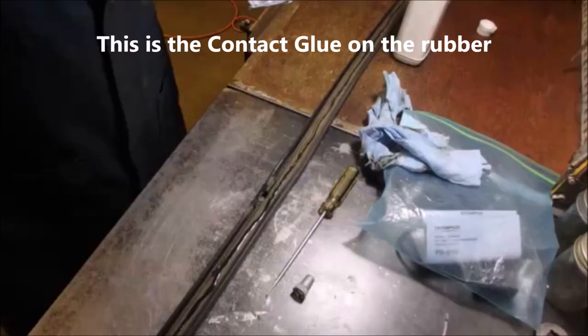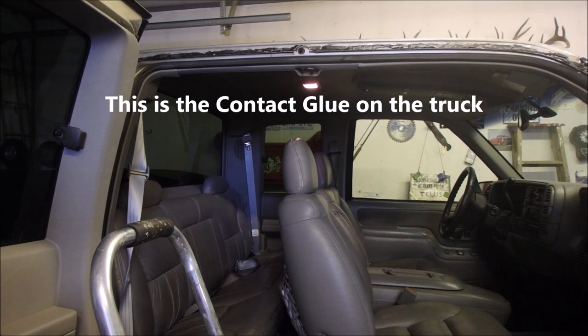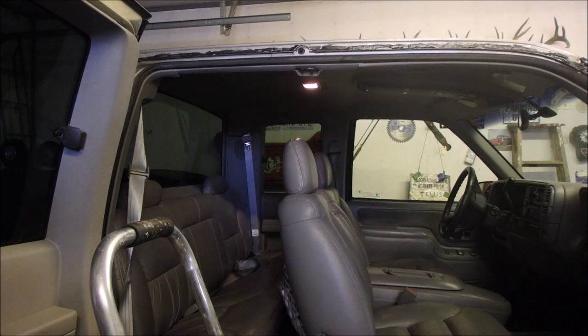Good. Now I'm just going to go clean the ridge of that, where the weather stripping goes on the truck. I'm just going to take a little tiny bit of brake parts cleaner and wipe that off. I will be right back. All right. So in just about the exact same amount of time it took me to get all the glue spread, it's been about 3 or 4 minutes. So now I just don't want to get any of this on my upholstery or...